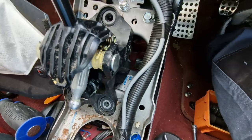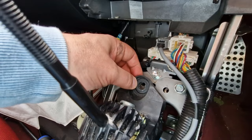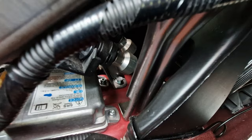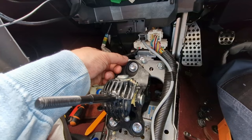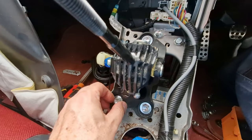He's pushing the little metal inserts out. This pry bar is a good size for just pushing them through — the top one was a little bit tricky, it's hard to get enough room to get it out from the other side. The rubber surround bushes are much the same, quite easy — just push them through. There are three bolts; I did the top one first, put the insert in from behind, did the bolt up just to catch the threads, and then did the other two.